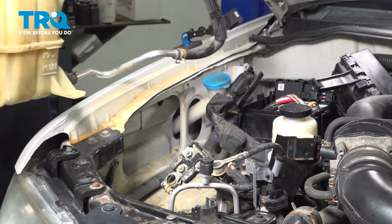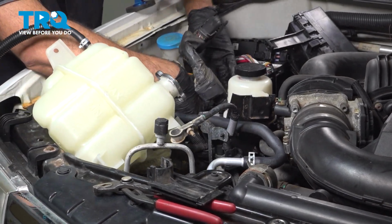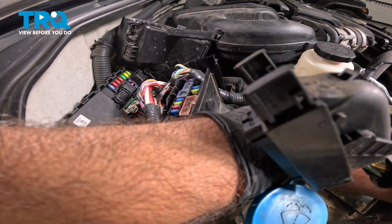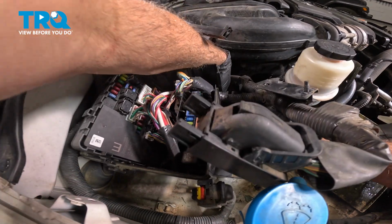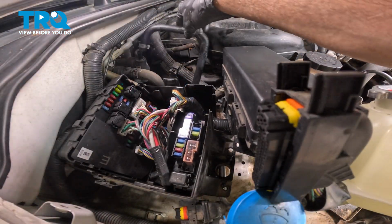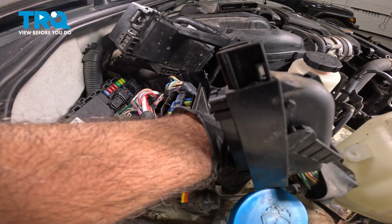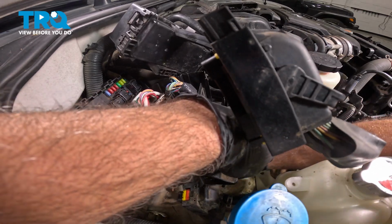And there we go. Take the new component, take the hose end, goes underneath the fuse block, underneath the harness. Push that through. Now we're able to pull our hose up over here, so just kind of tuck that off to the side and continue to hold up the fuse block, push the tank into place.